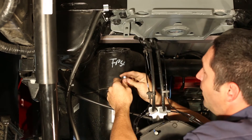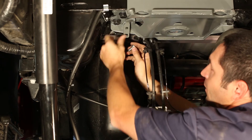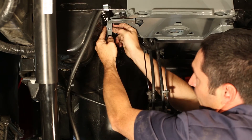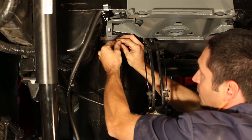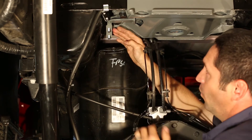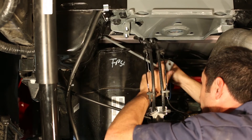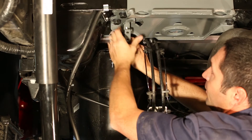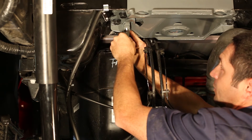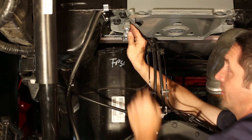You're going to love this new handle design. Instead of using a single bolt with nut requiring two wrenches, you'll notice two square holes in the latching mechanism for carriage bolts. Open the latch fully — this allows the bolts to go in from the top down. Work in with your fingers and get both bolts through the square holes. Once the bolts are installed in the handle, close the latch, then slide the handle mechanism forward of the brake lines, over the fuel tank, over the driver's side frame rail, and line the two bracket tabs together. They come with a flange lock nut, so no washers or lock washers needed. These can be snugged up and torqued to 30 foot-pounds.